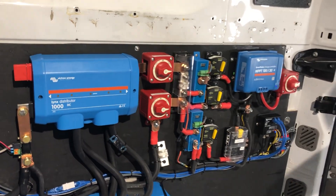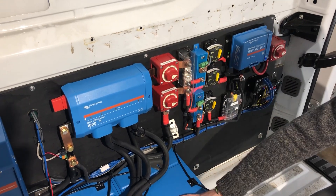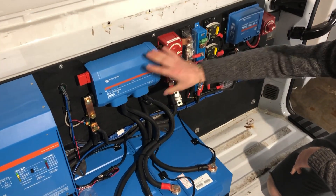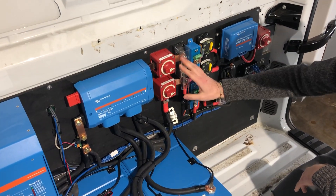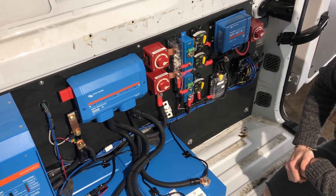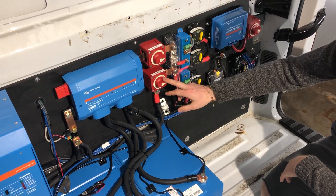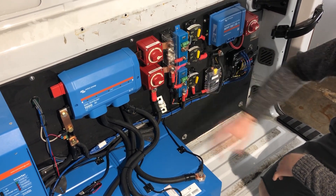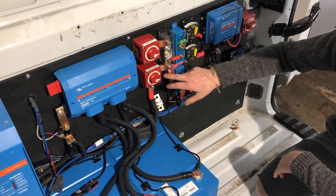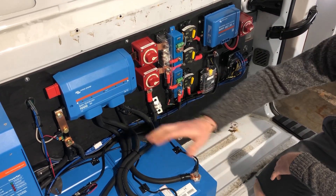These two red switches: the first is a master on/off. After the batteries come off with all their cabling through the links, this turns off the whole DC system — it disconnects your batteries, everything off. It is the master DC on/off. Below that, if you want to keep the DC on but turn off your inverter, this is just the inverter on/off, between this class-T fuse, turning the DC going into the inverter off.